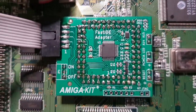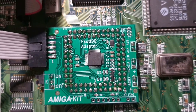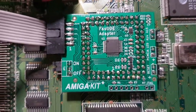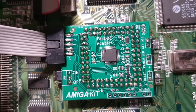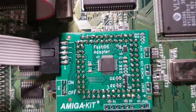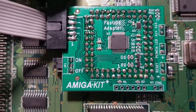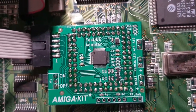There is actually a bug with the Amiga 1200s where if you have a PCMCIA card plugged into the PCMCIA slot and you do a reset, the Amiga will not see the PCMCIA card anymore — you'd have to turn off your Amiga completely and turn it back on. Previously I was using a library to fix this, but now this little module will actually handle it for me, so I'm not using that library anymore.